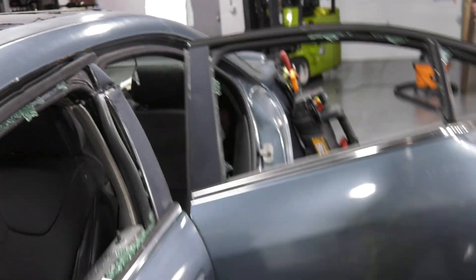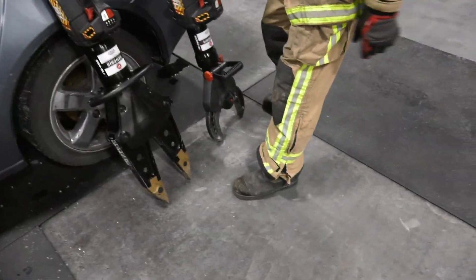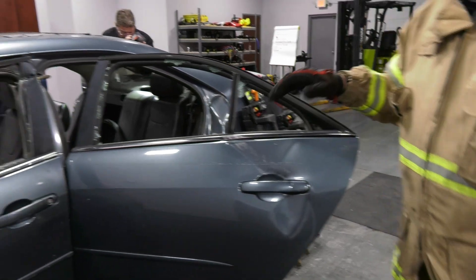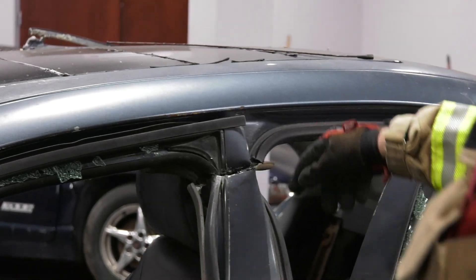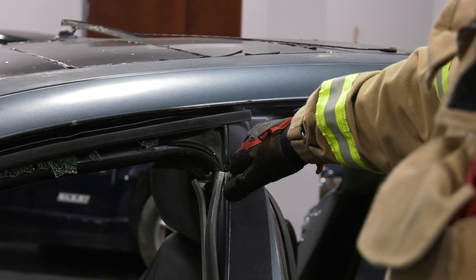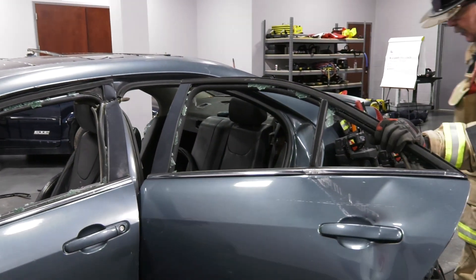All the way through. I know that the Genesis cutters have enough power so I can come straight in with that cutter straight in from the B post. Another option is that I can always V-cut the roof rail. I like to come straight in from the side, make that all the way at the top, and now I'm ready to go in and attack the bottom of that B post.